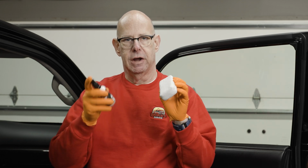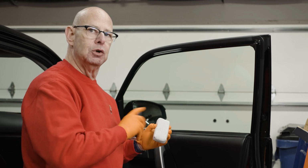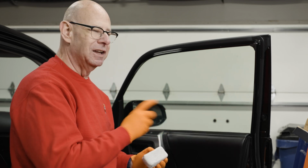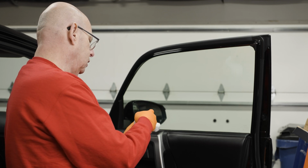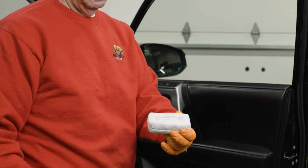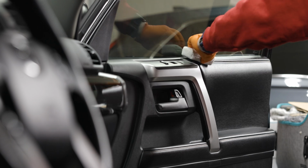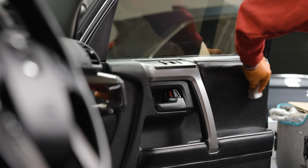And then we're going to saturate the applicator. We're doing that because this is the first time that we're using this applicator, so we're priming the applicator for putting on the coating. Therefore, we want to make sure we have enough on the surface. So we're going to put several squirts of coating on here to make sure, again, that we're coating that surface. Then I can apply straight to the surface that I've just cleaned with Diamond Body Prep.